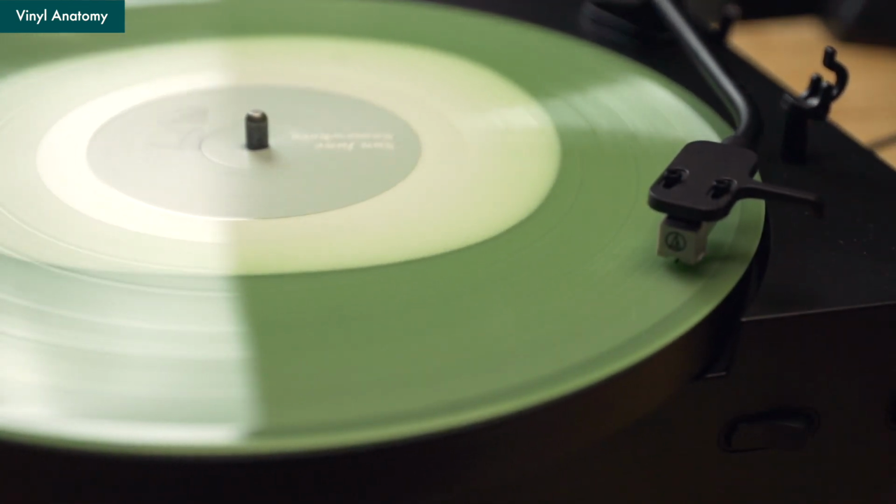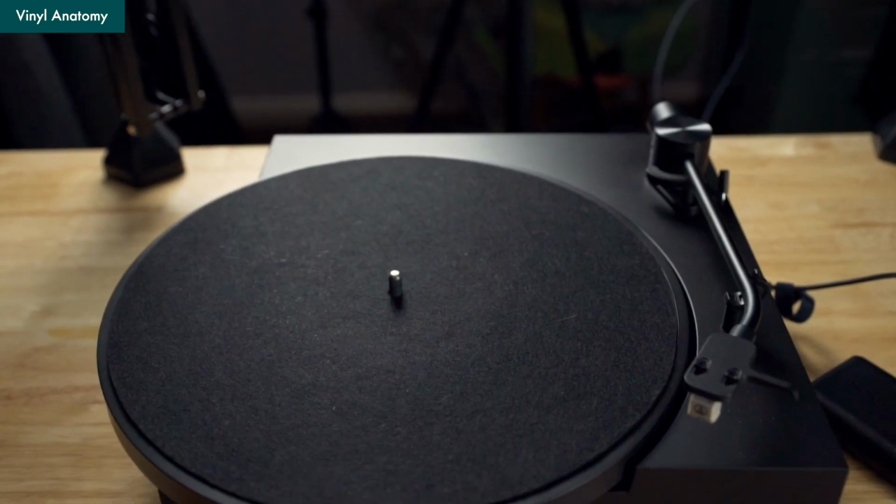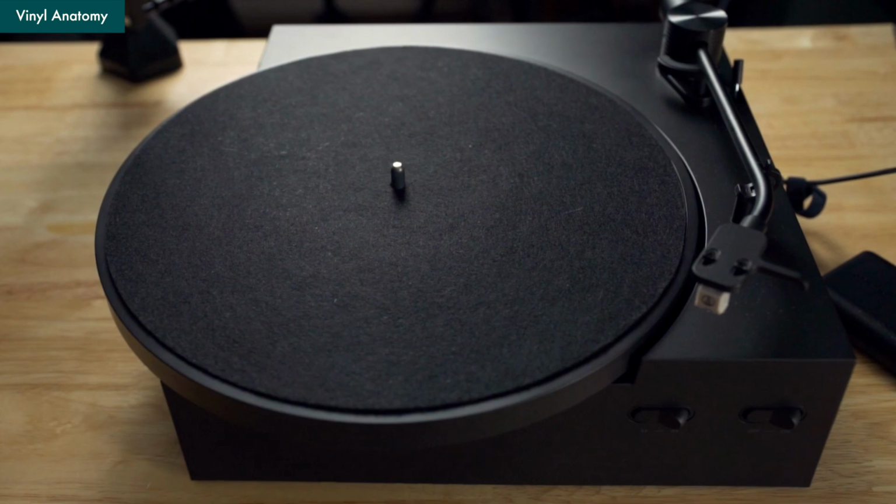The only way I can make it play stereo is by using the provided cable and plugging it into a pair of powered speakers using a 3.5mm jack. This is a baffling design decision, or corner cutting in the Obegransad's circuits. It greatly reduces where you can integrate the turntable. You will need components that have auxiliary inputs to make it work, such as Bluetooth speakers or powered speakers, because most traditional components in a stereo system do not offer such a function. I have never seen another turntable behave this way. On top of that, we cannot bypass the preamp inside the turntable. So Obegransad is designed for a specific scenario and for a really specific kind of people.